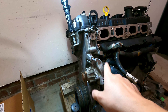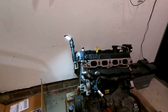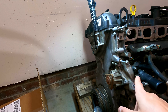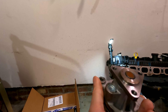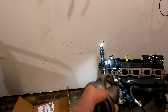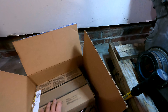We're going to work on this motor today. In case you haven't watched some of the other videos, I bought this car, paid $600, motor's bad. Got this replacement motor for $150 at the old LKQ. I'm still waiting on some other parts mostly for the transmission, but what I need to do is swap out the water pump. The old motor — right before they blew it — they put a brand new water pump on it, so definitely don't want that to go to waste. As preventive maintenance, I ordered a new seal from RockAuto, and got a rear main seal as well.